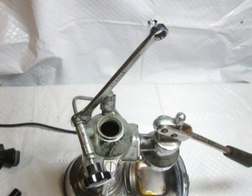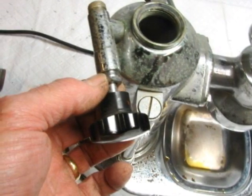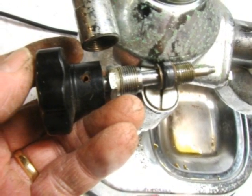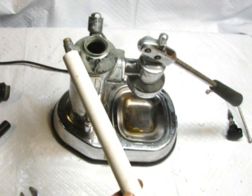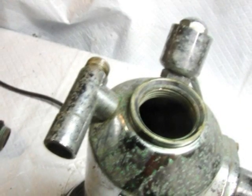Address the bent steam faucet body. We'll remove the wand, take out the internals. Short length of PVC pipe — apply it to the body. One movement puts it straight.